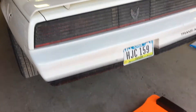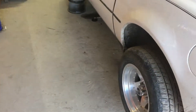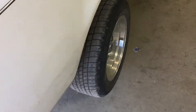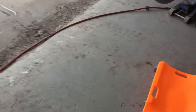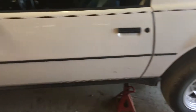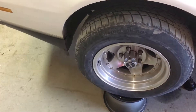I'll probably try to track down another 7.5, or I could upgrade to the 7.625 that was in the later third and fourth gen cars. While I have the tires off the ground, I'm going to swap the tires side to side — one is unidirectional and mounted backwards, so I want to get the traction arrows pointing the right direction. My plan is to get some BFGs for it anyway.